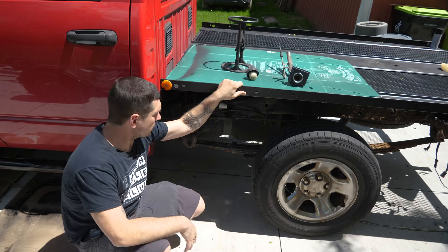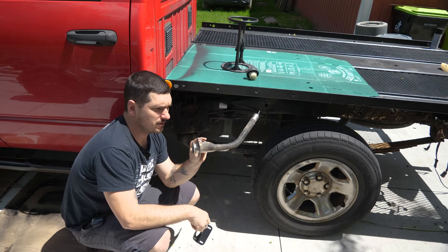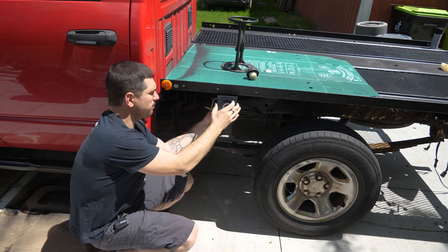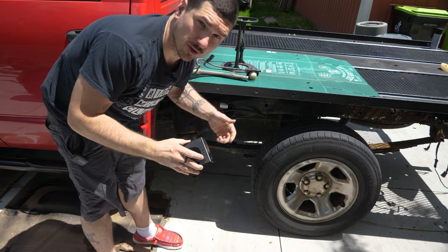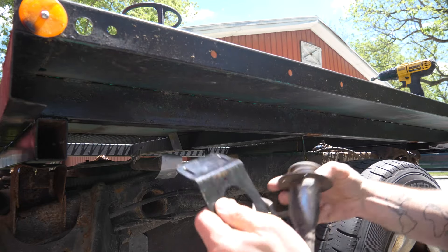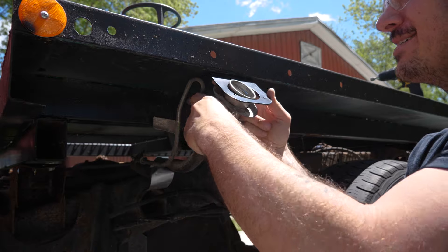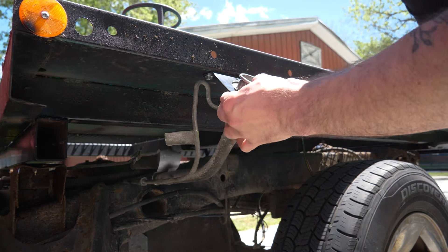Last day — let's wrap this up. For the fuel filler neck, I have this bracket I got on Amazon. The neck itself I pulled off and disconnected by drilling out the rivets. Both hoses need to sit in place — I'm going to bend the bracket back and we'll have to drill through the face of the trailer, but I don't really care. After some bending, it lines up pretty well. For now I'm just going to run some metal screws through it, and once that's secured you slide it through and line it back up. Since this is now significantly lower it's also a lot closer, so I'm going to cut this hose so it lines up better — just relocate the hose clamp, line it up, and shove it on.